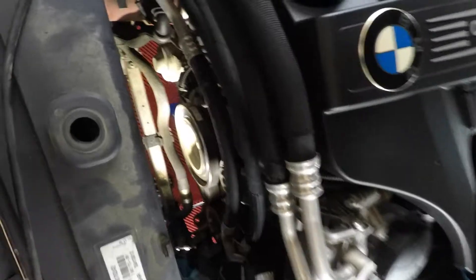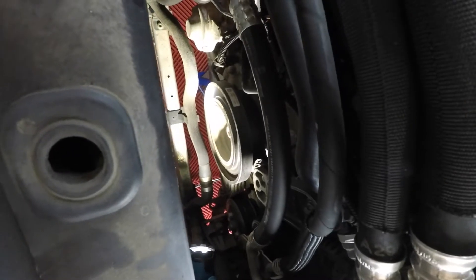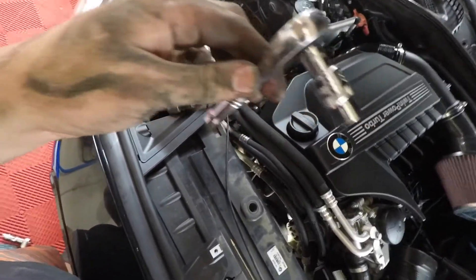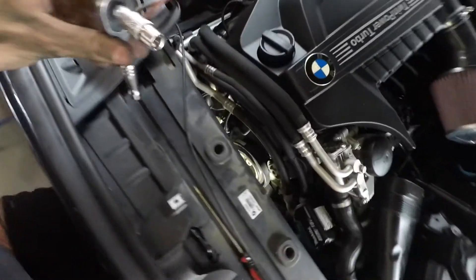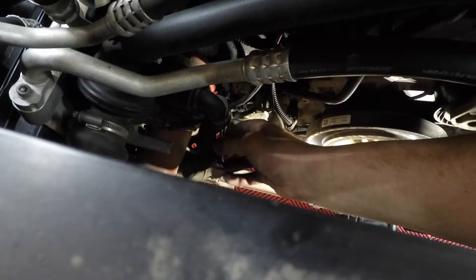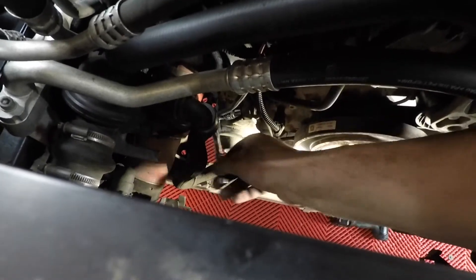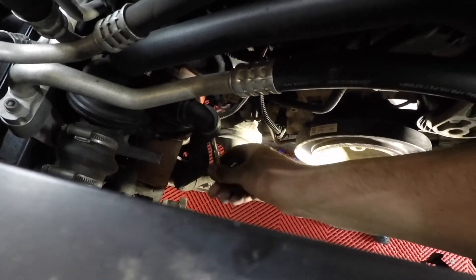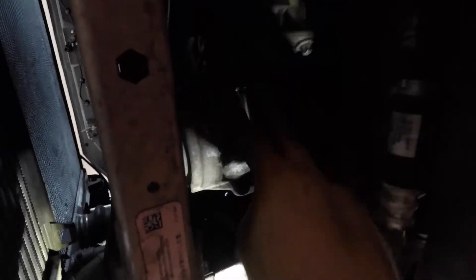The hardest part of this job is the top bolt on the water pump. There's a metal clip holding a wire — pop that off to give yourself room. I used a mini socket with an adapter to get to a 3/8 slim-wall socket, going under the hoses to get the socket in position and ratcheting away. A mini ratchet makes your life much easier. Tackle this bolt first — once you get it, the rest is easy.